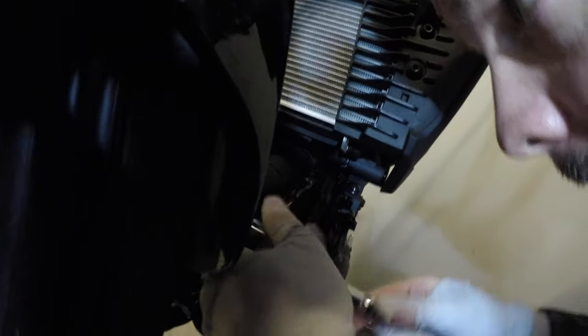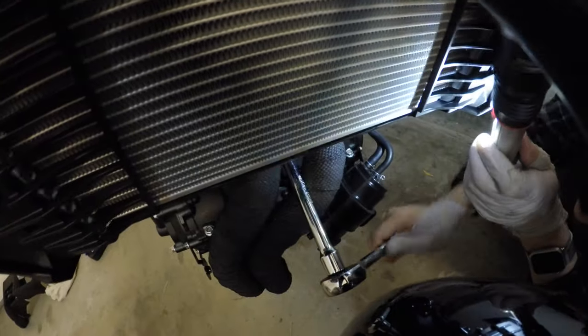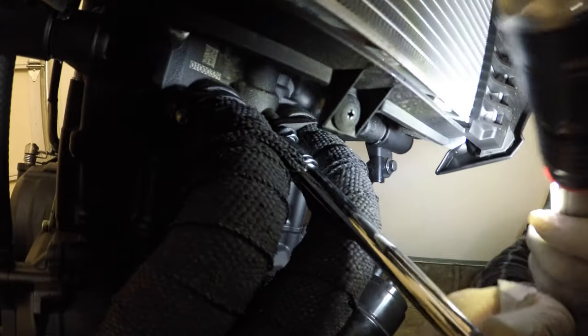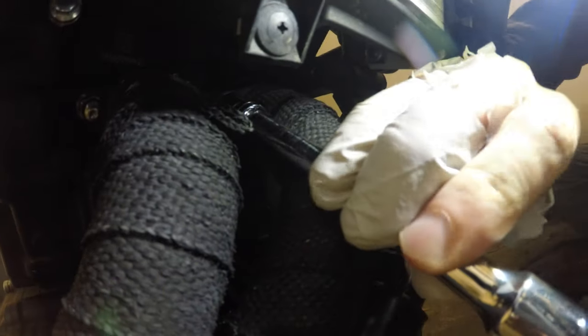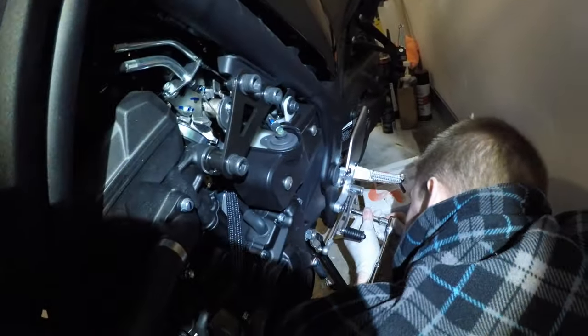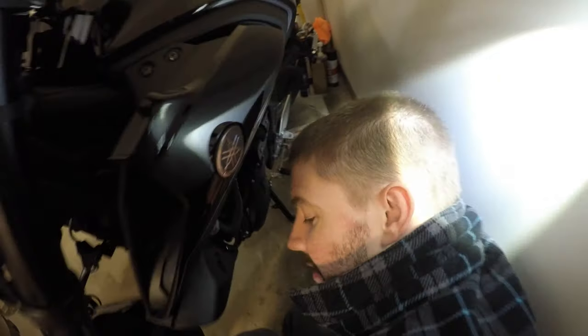We're just summarizing — we're going to tighten up all these bolts. The front wheel gets in the way here with this size extender; I don't have any other 3/8 size extenders, so I had to force this one. Moving our way in, this inner one was the hardest. That glass fiber — I had to move it and push it out of the way a little bit to get the clearance I needed. Tighten that all the way down, continuing until everything's snug, going back and forth. You want to make sure your exhaust header is pressing in evenly on those copper washers. Near the shifter, there's a bolt that holds the catalytic converter on the other side.